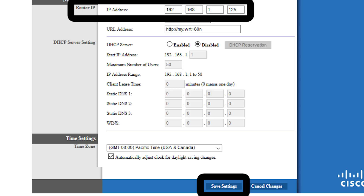After disabling DHCP, you need to set the second router's IP address to one that will fit the network created by the first router. Set the second router's IP to 192.168.1.125. If this doesn't work, try 192.168.0.125 or 192.168.2.125. Different router manufacturers use a different third digit, so one of these three should work for your router.